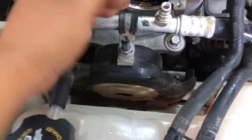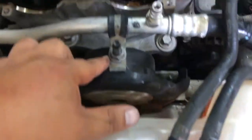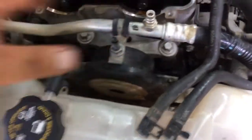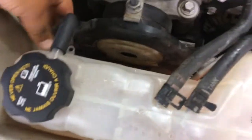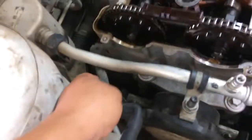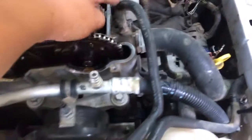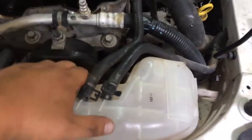I managed to get this engine mount out of the way — there are bolts right here, another bolt here, one there, and one there, and you've got to take all that out. There is another bolt down in here and I'm going to try to take this off as a whole assembly so I don't have to remove the coolant reservoir. But if I can't, there's one bolt holding the reservoir in and one clip, then you have your overflow hose which just goes down underneath the car. Remove the clamp that goes here to the engine block and you can remove this hose — however you feel safer doing it — and then your reservoir comes out and you'll have more space.